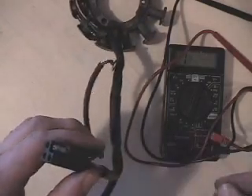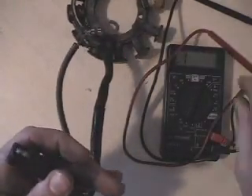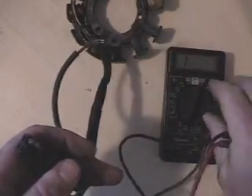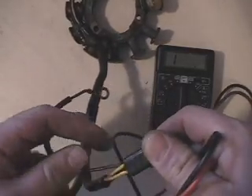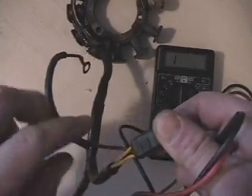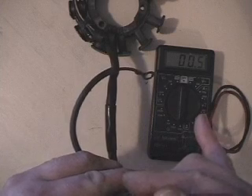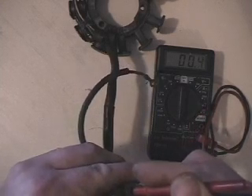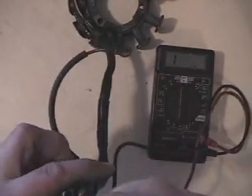So let's go ahead and do our quick electrical test on this — test our ohms. If somebody just wanted to check their lighting side or power side to make sure there's no breaks in the wire, put your multimeter on the lowest setting. On mine, I put it down to the 200 setting, because you're basically just looking for continuity. The ohm readings are going to be very low. Find your two yellow wires coming up to the plug and use those two female connectors. It's only going to be 0.4, 0.5, maybe 0.6 — very low readings for the power side, just looking for continuity. You can also check your ground to make sure it's okay.